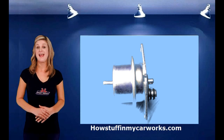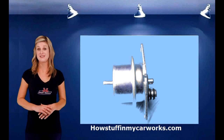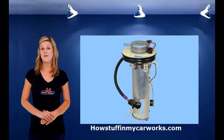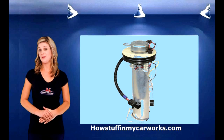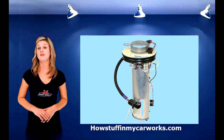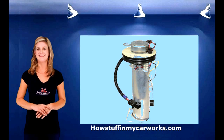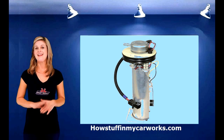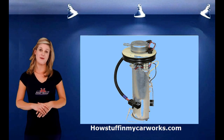The fuel return line allows the excess fuel to travel back to the fuel tank. On most vehicles this is usually attached next to the regulator. Take note that on some makes the regulator is attached to the fuel pump module located inside the fuel tank. In some cases the fuel filter is part of the fuel pump module located inside the tank. Due to their design these tend to be more expensive than the more conventional system described earlier.